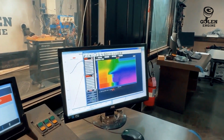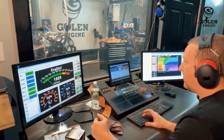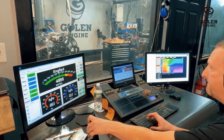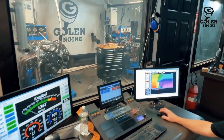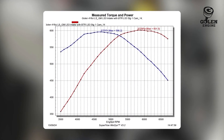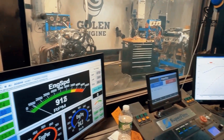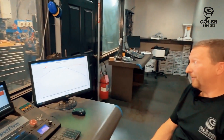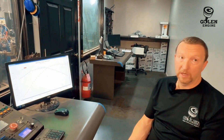Go to 26 degrees and let's run it. We did a lot at 28 — I would not expect a cam this small to do that. Plus we got the compression right out there at 11.5 to 1 with this engine. Made the same torque as last time, 596, but 601 horsepower — which is just amazing. It goes to show how much power these LSs will make with a small camshaft. You just don't need a ton of camshaft.